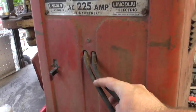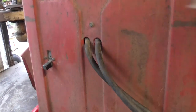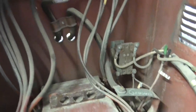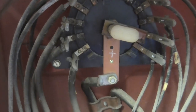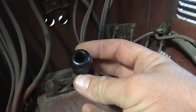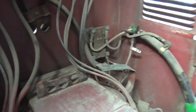For my machine, the side towards the on switch is negative and this side is positive. What that correlates to back here is this tang coming up is the ground. You can see the plus symbol there — that's the positive coming in through those holes. What I'm going to use coming out of these holes — it's probably a little bit overkill — but I've got these strain relief grommets. They fit pretty nicely on the 2 gauge wire.